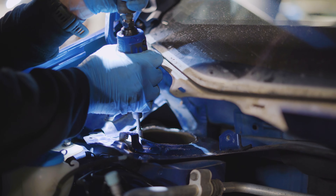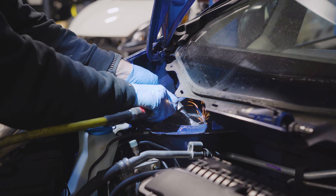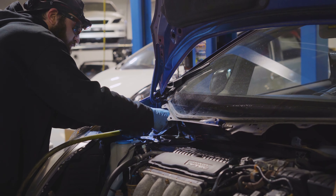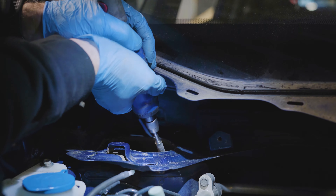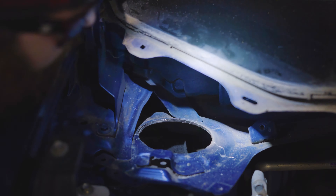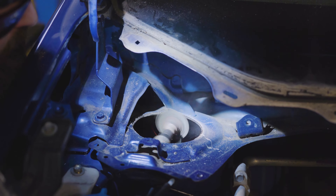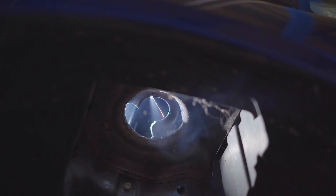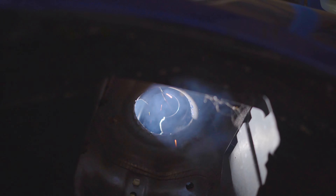You can see he's got a rough cut in there now; he'll go back and clean it up with a die grinder. Just slowly getting that top cut smoothed out, looking nice, uniform, and even. If you cut at that line or just slightly above it you'll see this nice little upward-swept curve where the rubber top hat used to touch the strut tower — that adds a little bit more rigidity there. One of the main reasons we like to do the full top plate rather than center-located caster adjustment devices on the market is these strut towers have a habit of breaking spot welds when you go up in spring rate. By dispersing the load farther out on the strut tower you reduce the likelihood of breaking spot welds and cracking the towers.